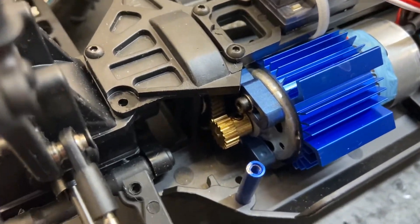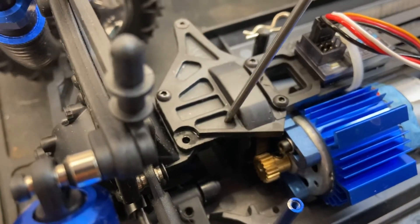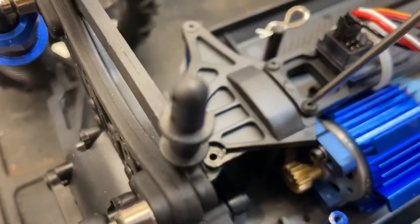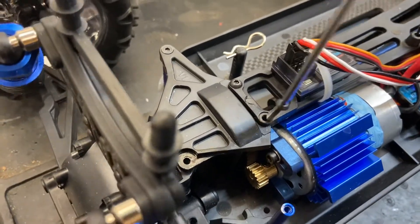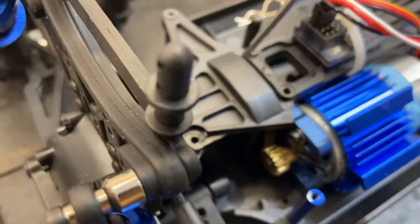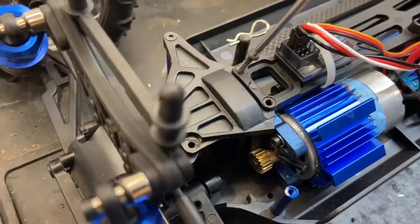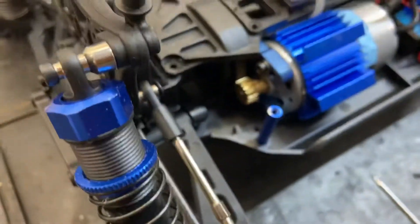If you can't see and it's still locked, you need to take the rest of this gear cover off — there are another four screws. I'll use an electric driver to make it a bit quicker. Just be careful you don't get your screws stuck to the motor and lose them.